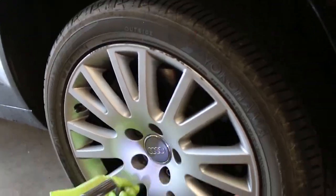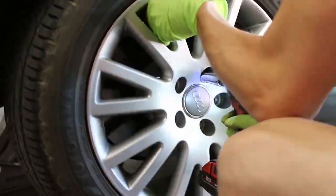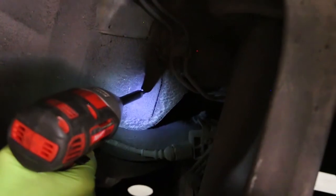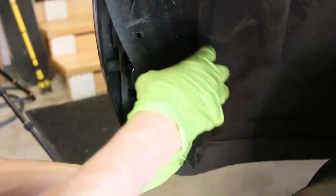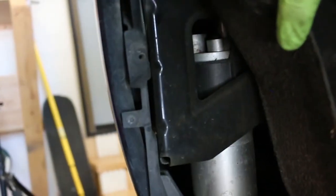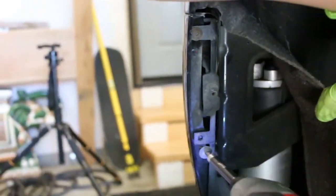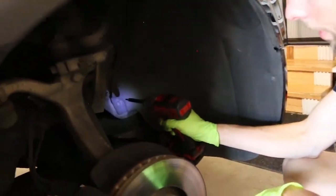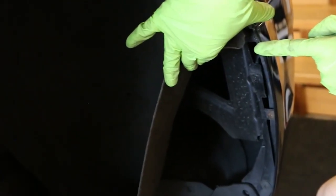Now that you have your wheel removed, you want to remove the screws here. Thankfully the previous owner already removed them and threw them away, so no need for me to do that. You have a T25 right here and you might need to take one of the upper ones off as well if you need more room. Once you take this one off you'll have access to the bolt you need. There's also a T25 in here, so we'll remove that, and then it exposes both of these — they're T25s — one down here and one right here.